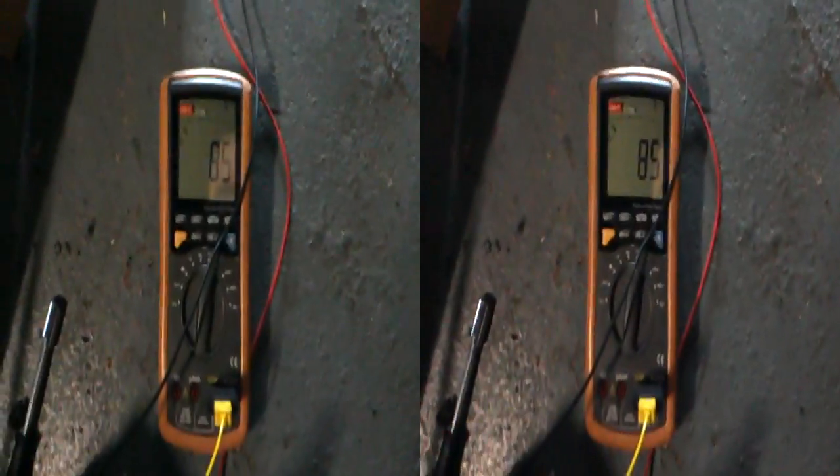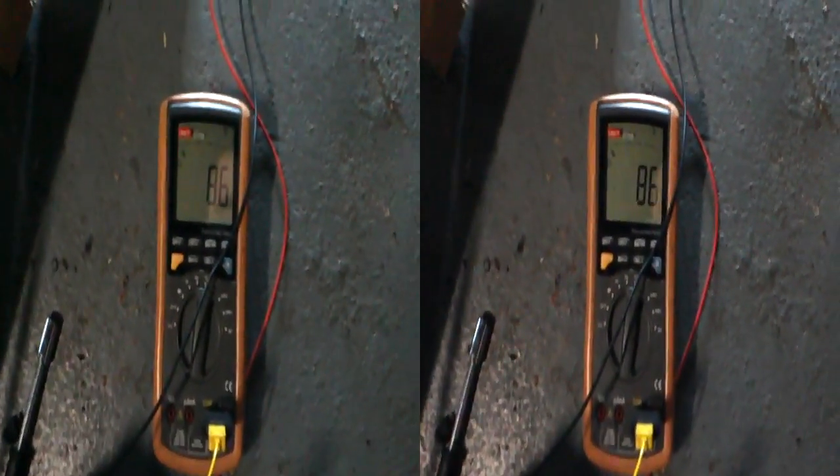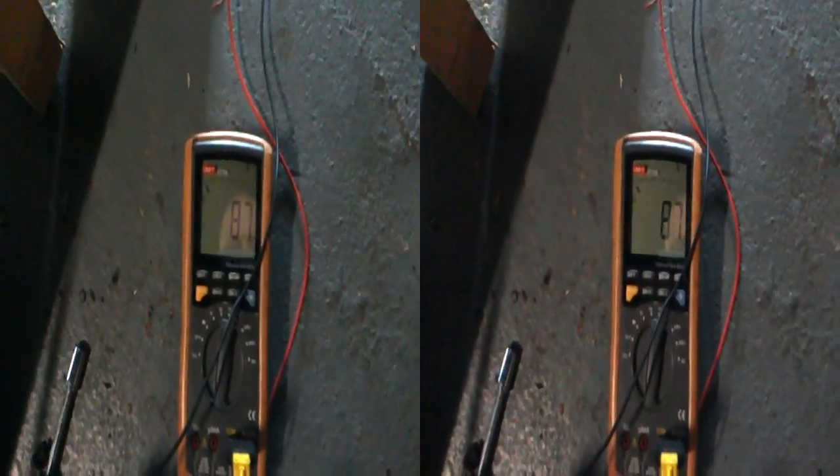This is a 70-grade sensor, just so you can see — I'm actually measuring the temperature itself. Measuring it under the base of the cylinder head, which is usually the hottest point, where the cylinder head joins the body. Oh, it's 80 degrees. So I moved it slightly — it's obviously getting a better reading. It's now gone up to 87.